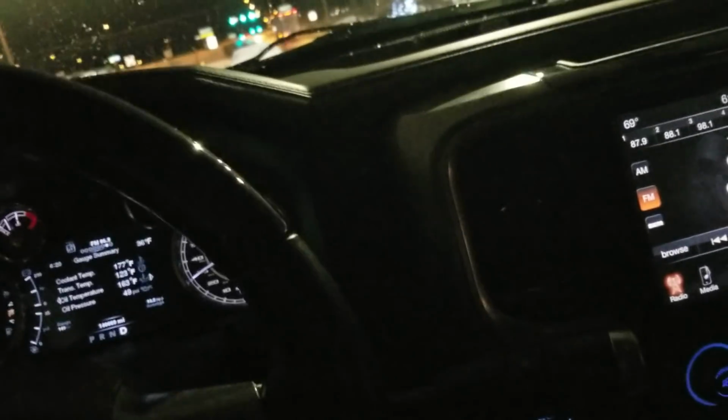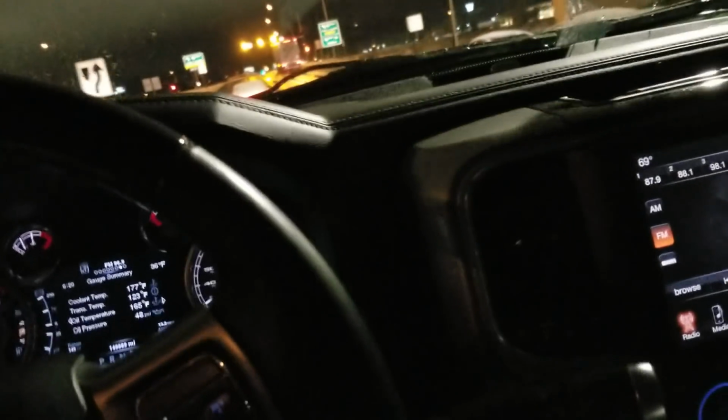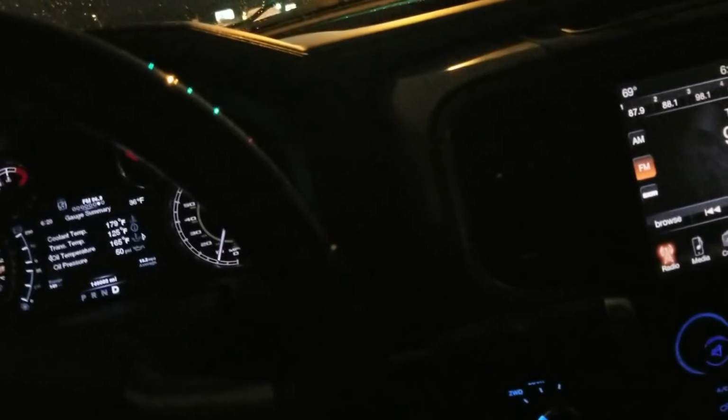Now it might be a little out of reach for some guys to understand the combustion, where the explosion happens and how your engine runs. It might be out of range on temperature. What that means is it's not burning clean. If it's not burning clean, that means there's excess fuel. It goes right back to your oil getting polluted, if we could say so. Your oil's getting bad molecules. Your oil's getting watered down. It's not really watered down, I'd call it fuel down, but you guys know exactly what I'm trying to point at here. And things go to crap.